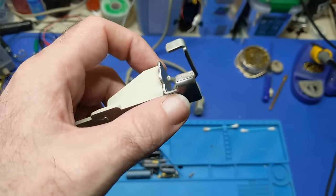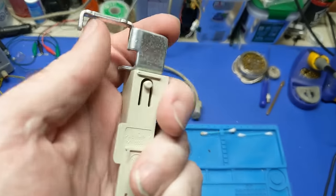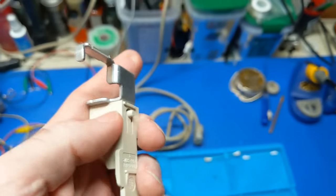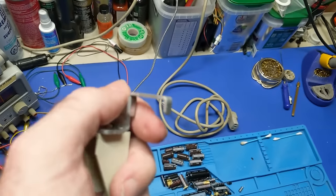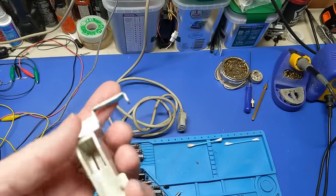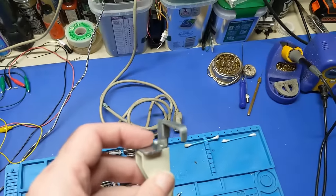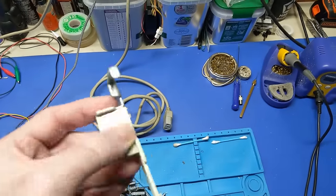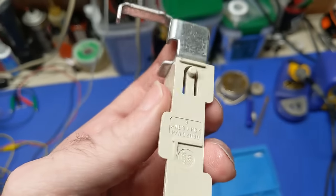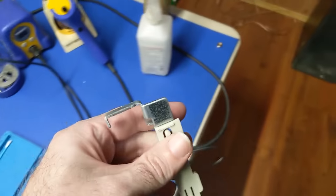All right, so the floppy drive has been serviced. I glued the stakes back into the plastic, so it's not going anywhere. It's perfectly fine for now. The likelihood the floppy drive will get used a lot is very, very low, but it's glued together, and if it doesn't hold, then the next best thing would either be epoxy or take a piece of VHB and stick it in there, clamp it or something like that. But yeah, ABS plus, anytime they do these blends, that plus crap, it gets extremely brittle.